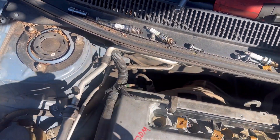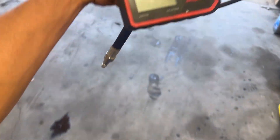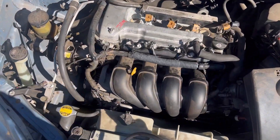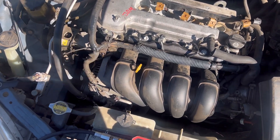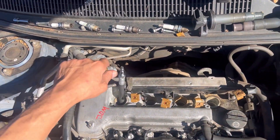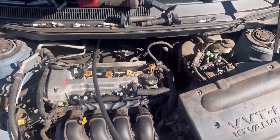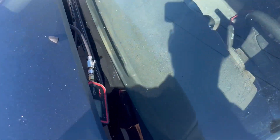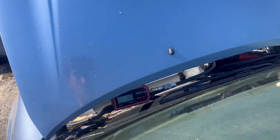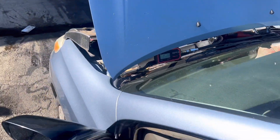This plug looks great. Let me go get my compression tester. I got a fancy digital wireless pressure tester from Snap-on — paid around five to six hundred dollars. It does oil pressure, fuel pressure, and vacuum. I'm going to do cylinder number one for a baseline — all plugs out, pedal to the floor, and we're just going to crank over the engine. About 160 PSI for that cylinder.